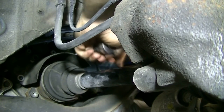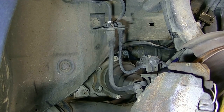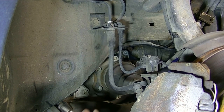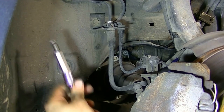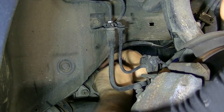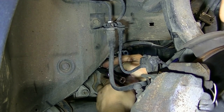There we go — third and last bolt. Here's the shield. Time to get these bolts off. For these you'll need a 10mm triple square bit, available at almost any auto parts store. For this one we also need a 13mm socket. Put it over it and make sure when you put this in it's seated all the way and all the teeth are engaged inside of the bolt.